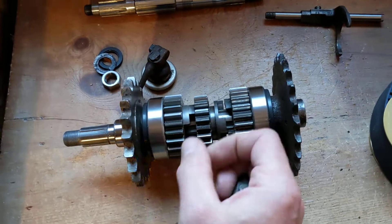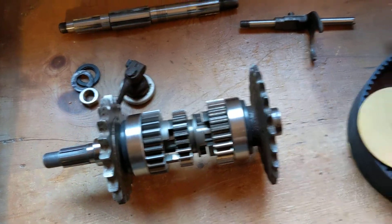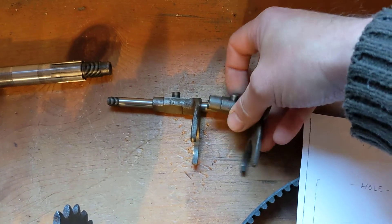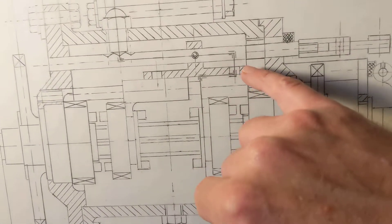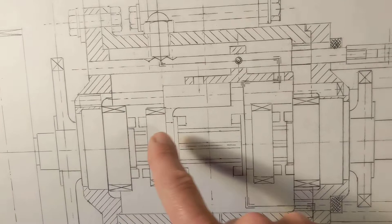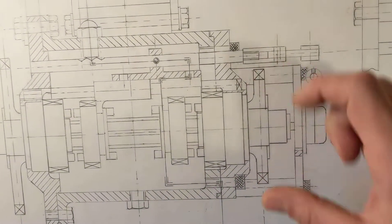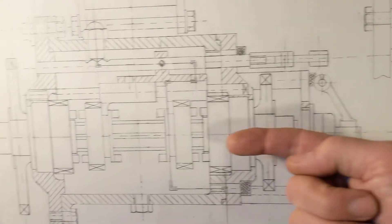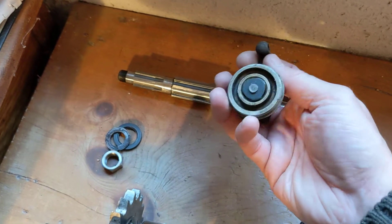The selector forks look like this - the selector fork goes onto the dog like that and moves the dog backwards and forwards. We've got two dogs because we've got the longer shaft and a longer distance between them. On the same shaft we'll have the two dogs locked together with this piece here. By moving the shaft backwards and forwards, that moves the two dogs to engage them on the left or right side. There's the clutch, the low speed, and the high speed drive sprockets. On the very end is the mechanism to push the push rod through to release the clutch - as you pull the cable it pushes that centre piece via a little screw inside.